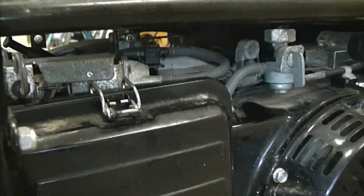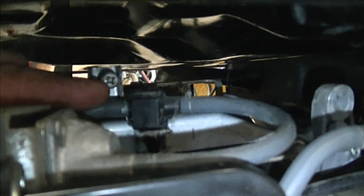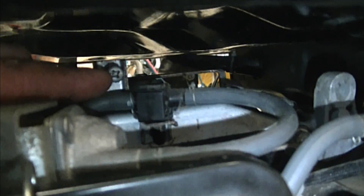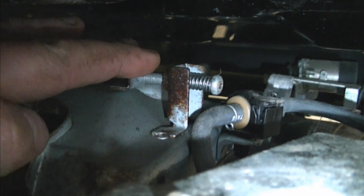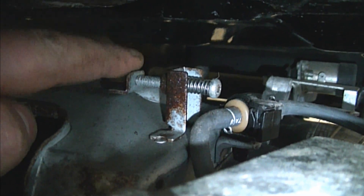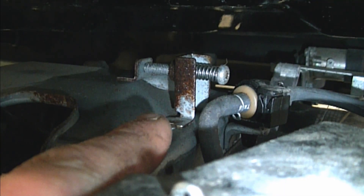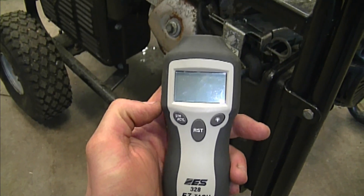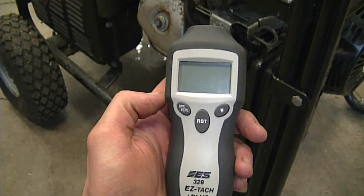What you need to do is look above the carburetor on your engine. You're going to see a screw right behind it, above it. You need to turn this screw in to make the RPMs faster. If your engine was revving too high, then you would turn it out. Here's a view from the side — you can see that when you tighten it, it's going to push the throttle lever or governor, and when you unscrew it, it's going to make it go back. So I need to turn that screw in a few turns until the RPMs go up, and I'll be reading the RPMs while tightening the screw to get it around the desired RPMs.